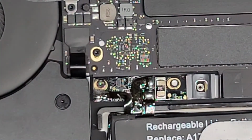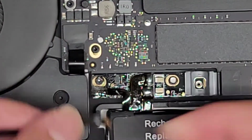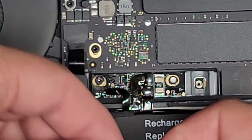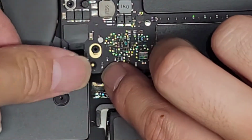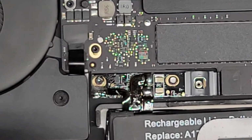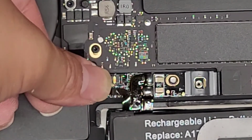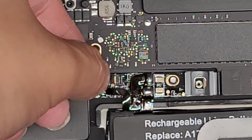All right, now we're going to get this ribbon cable back in. Make sure the latch is up on the new battery. Okay, get that cable in. All right, oops. That cable in. Again, it can be a little tricky. It helps to flatten the cable back out, and then you can use that to wiggle it and push it into place. We might have to use a little tape or adhesive to do this, but let's see. Okay, there we go, it walked into place.